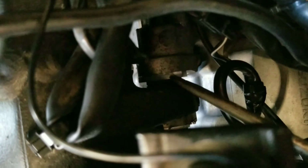And as you can see here, this is the engine right here, and right next to it, if you can see that crack right here, this is the thrust bolt, this small piece right here. This is actually like a pinch mount, so you unscrew it counterclockwise and it relieves pressure off of here. It's not tight by any means because it wasn't meant to be tight. It's just meant to keep vibration from the motor moving back and forth.